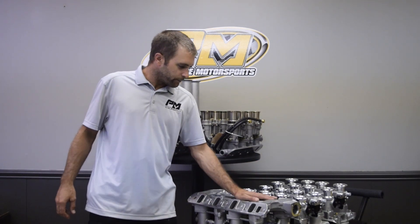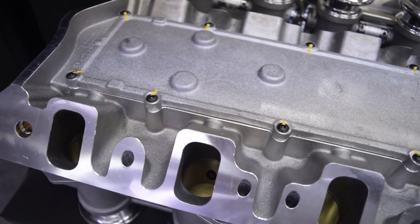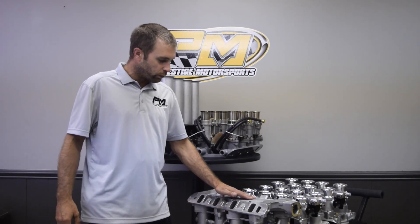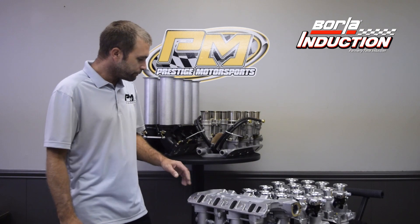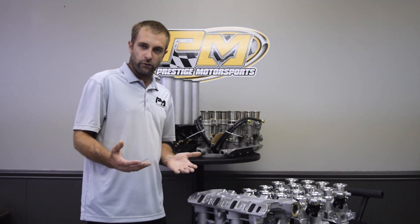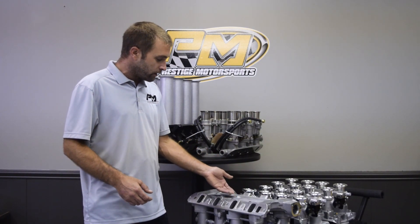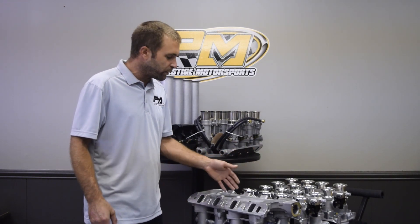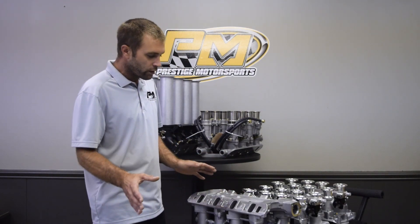We'll start with this one that I've got upside down here. The reason it's upside down is that even though there's an individual runner per cylinder, there's what they call a common plenum. It's very important that this plenum is available on the system that you're looking at. Borla, hands down, is always going to have it. Especially with fuel injection, we need a common area where we're going to take manifold vacuum from so we can tune the EFI system. One thing we do when these come in: it's very important to take this plate off, as sometimes there are metal shavings left behind. A good engine builder is going to take that off and make sure all of this is clean before final assembly.